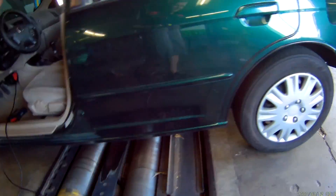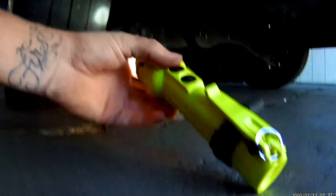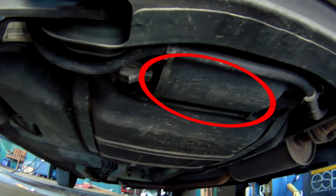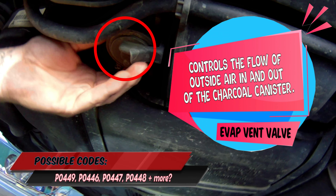This is all to do with emissions and hopefully getting everything to go through the cat and get cleaned up. Here on the back of the vehicle, this is where your vapor canister and vent valve is going to be located. They both don't look too hard to get to. First off is the vapor vent canister right here — they usually don't go bad, and you should see some moisture around it if it is bad. Next is the vapor vent solenoid. You'll be able to find the links for these parts in the description below. This allows fuel vapors to flow in and out of the fuel tank, or allow air in or out of the fuel tank or the evap system. So if you have a fuel pumping problem, that vapor vent solenoid might be one of the first components to go look at.